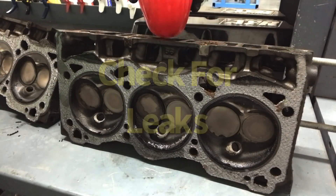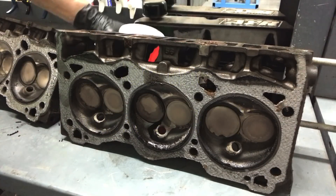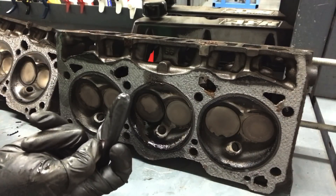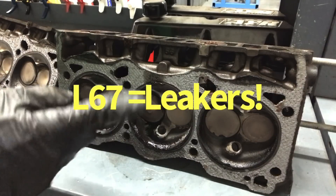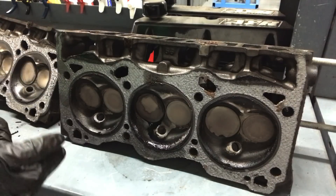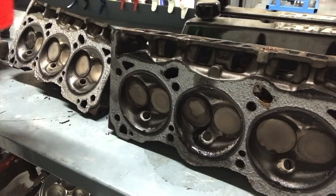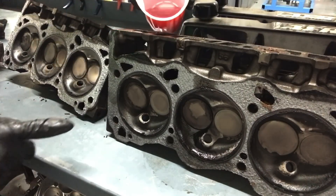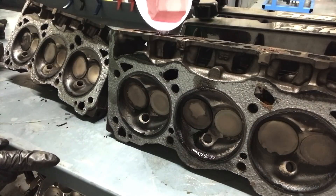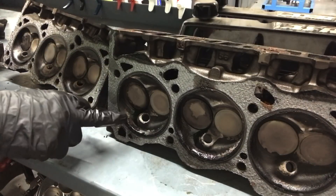So what we want to look for — we're going to pour some gas in here, in the intake port — and we can see it's just running out the valve. That valve is leaking, so we're going to check the others and see. A valve job at least is necessary. What often happens with these is it sinks the seats, so sometimes you have to replace the seats. The very minimum, a valve job is necessary. She's a leaker.